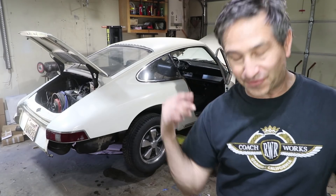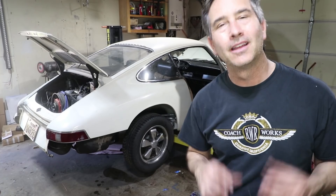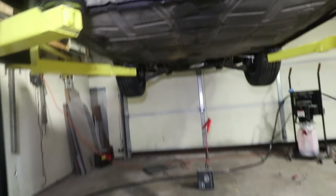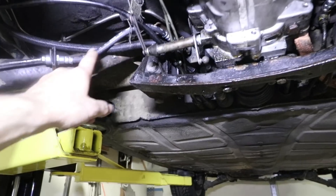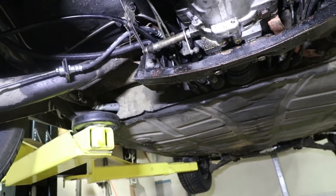The oil leak is fixed - I'm so relieved, that was a big job. Now I'm on to the brakes, just got to keep all that fluid where it belongs. I made a mess down here with the brake lines; I just flushed them out and got them replaced. This is the flex line that was completely corroded and really firm. I'll show you what I found - that's the driver's side and that's the passenger side. I cut the brake line in order to get my socket on there since they've been on this car so long. I really wanted a good grip on the fitting to get the old ones off - just snipped them, put the socket on. To get the new ones on you really need the flare nut tools, which I have, and that's also helpful for torquing them down correctly.